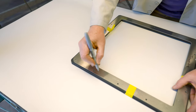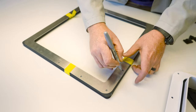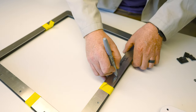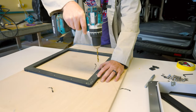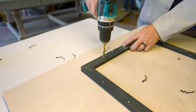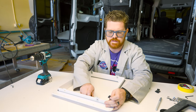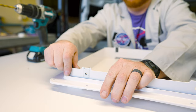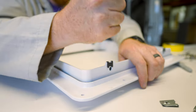With my flange on top, I'm going to go around the outside and mark all of the holes on my flange adapter so I can match drill all of these and make my installation super easy. With all of our holes marked, we're going to use a quarter inch drill bit and drill these holes out. The next step is going to be removing the screw guides from the Max Fan installation flange and replacing them with these bolt-in sections from Van Project One.